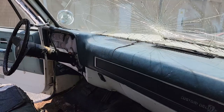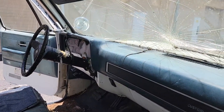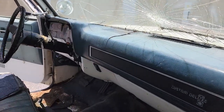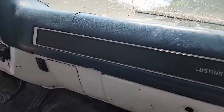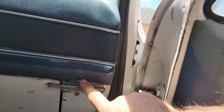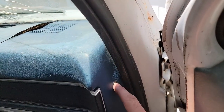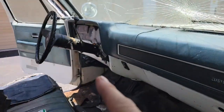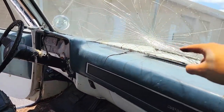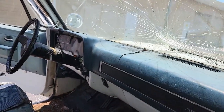Just a little thing on these dash pads — nothing to taking them out. I'm not going to video it because I have no way to hold the camera and do it at the same time, and there's a million videos on YouTube. But there are one, two, three, four seven-millimeter bolts — some have them, some don't. Mine had one right here; there's not one on that side. Then there are three or four clips along the windshield that duck down underneath.